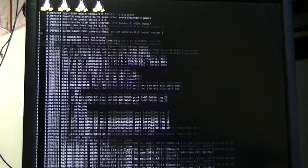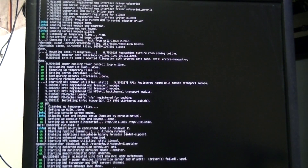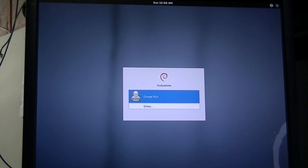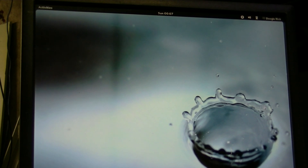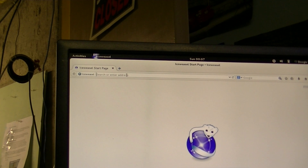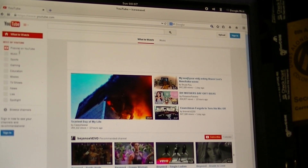I use this system as a server and Linux box. OS X isn't going to cut the mustard here — it's not supported on PowerPC anymore — but Debian hasn't abandoned it yet, and hopefully will continue to support it for at least a few more years. The main hard drive cage contains two 2TB hard drives in a RAID 1, providing a large storage area for backups and other data. I have plans to add a SCSI card so I can continue to use my tape drive from the old system, as well as maybe a fiber channel card so I can use my disk drive array. Booting from the SSD card directly is not supported, but I use a Parallel ATA flash solid-state disk on the Parallel ATA bus with the optical drive to provide a viable boot path and Linux kernel. Once the kernel drivers are loaded for the SSD card, this system flies.